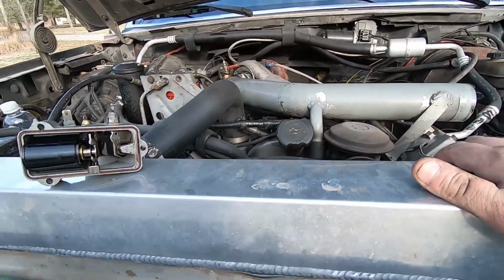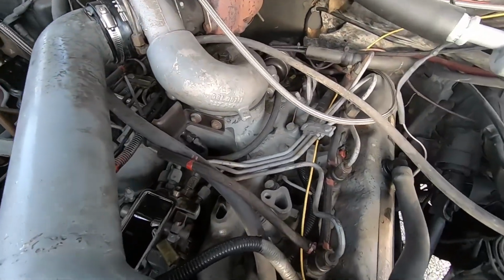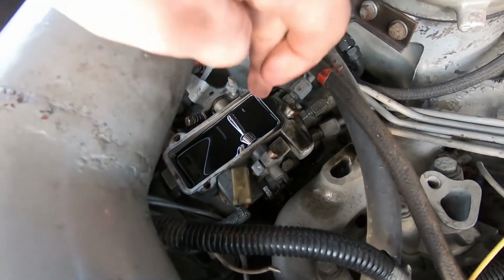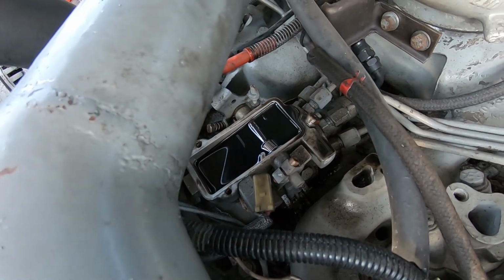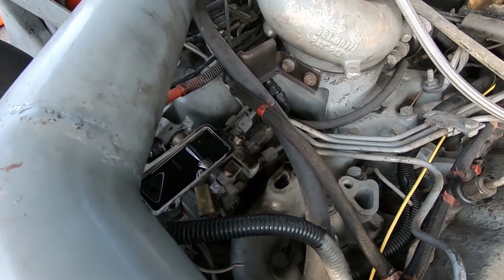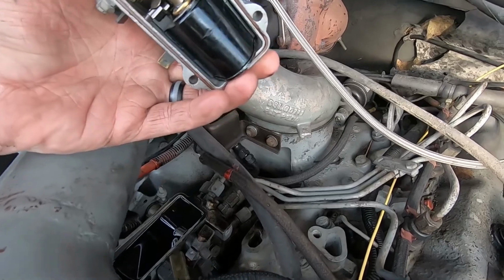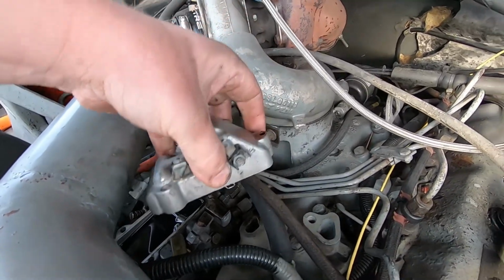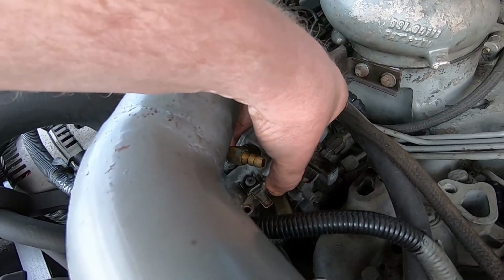But yeah, let's climb on up here. And as you can see, I've got the cover off the top of the pump. Yeah, diesel fuel's black, don't worry about that. But the trick to reinstalling this piece here and not causing a runaway condition is to set it down in place on the pump, but sit it forward.